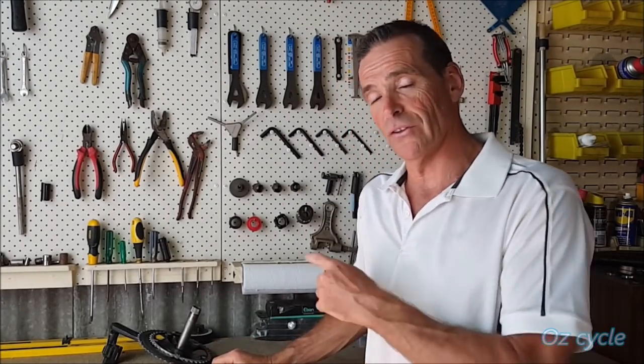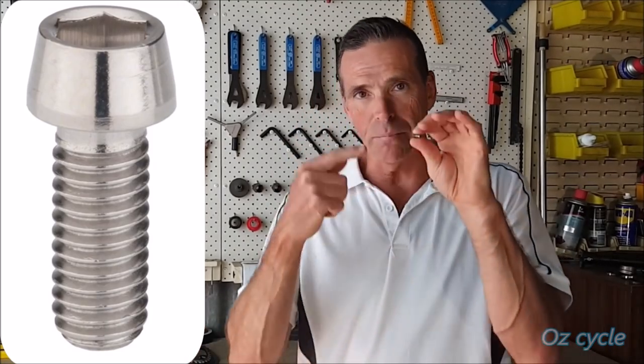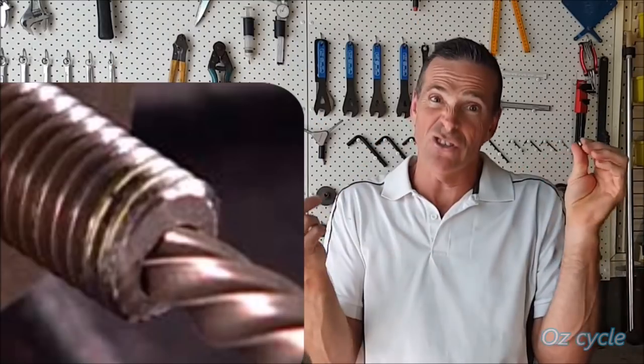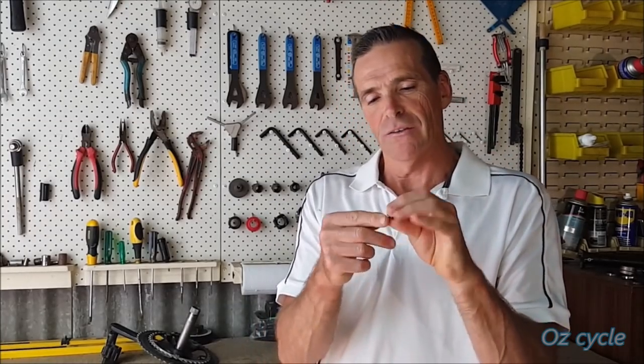There are a couple of ways of doing this. You can get a drill and drill the center of the thread. Bear in mind these bolts are stainless steel, which is very hard. With drill bits, if you're not holding the drill dead straight — like with a drill press with the crank in a jig — if you're just using a hand drill, it can and usually does go sideways. When you put your easy-out in, you can only use a certain size, and it starts to hit the walls of the thread, and you can quite often snap the easy-out off inside. Then you're in more trouble. You need to drill that hole nice and central, and then you'll be right.